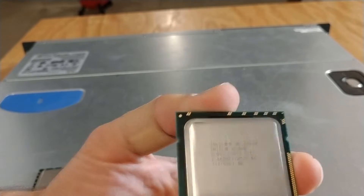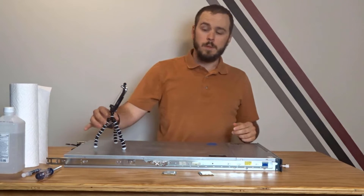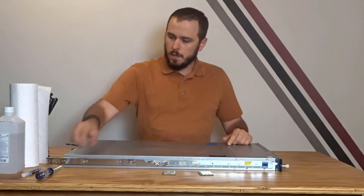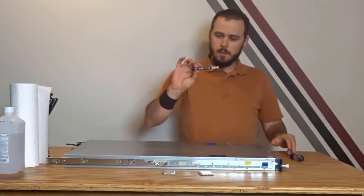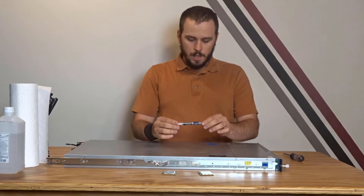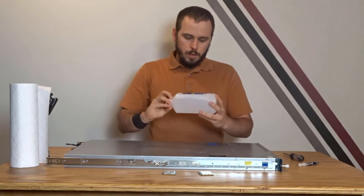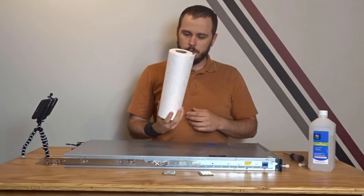So we're going to do that quick swap here, which is going to be a great way to improve our performance. Now to do a CPU swap like this you need a few basic things: a screwdriver for getting your heat sinks off, some thermal paste to replace the existing thermal paste — we have Noctua NTH1 here, which is really nice, a lot nicer than you need for a server like this — some isopropyl alcohol for cleaning off the existing thermal paste, and some paper towels for doing the cleaning.